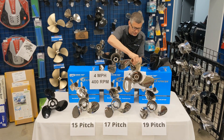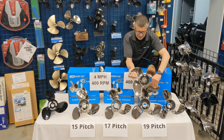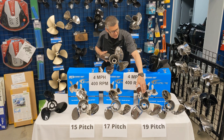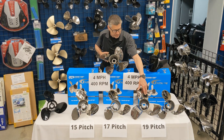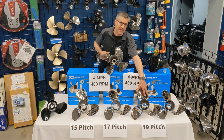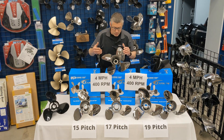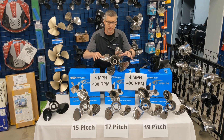You see the size difference of these blades versus those other blades? The reason why I have to increase the surface area of the propeller blades — with the three blade OS, the offshore — Mercury's got the same lineup going on too with their big huge lineup behind me. The biggest thing is I'm trying to show you the size of the blades. The paddle used to push the Titanic is a lot bigger than the one used to push your normal runabout boat. The reason is efficiency of the paddle to push the weight. The heavier it is, the more I need the motor to be able to manipulate the boat. Right now, if the boat's manipulating the motor — if it's just a little toothpick trying to push a big boat — it's not going to happen. So the tools of the trade: the bigger the boat, we try to compensate with either more guys canoeing for you, more paddles in the water, bigger paddles in the water to give you a better push. The heavier the weight we're pushing, the bigger the paddles.